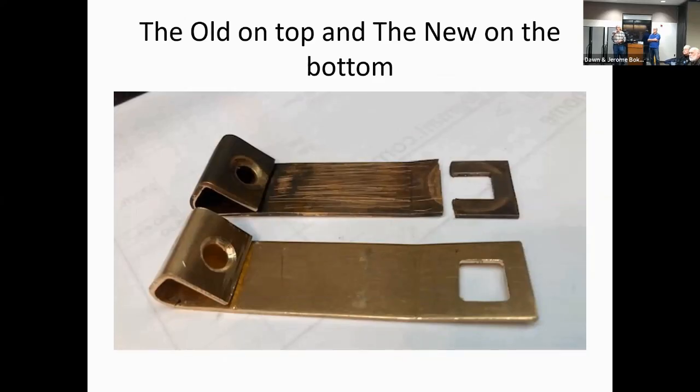So you can buy new starter switches for $30. They don't look close to original. The internals are not. I probably did 30 of them for Vince's car, with all different reproduction and original parts. Some of them are brass, some are copper inside, but the strength of the copper is not the same. There were some that were so soft that once you pushed it down, they wouldn't come back up. They're just all over the board.